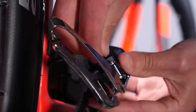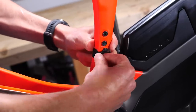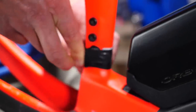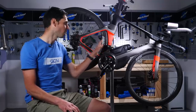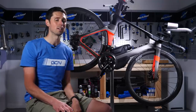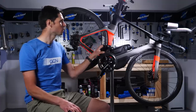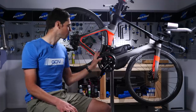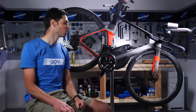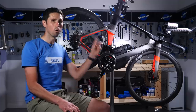Once the derailleur is off, you can decide what to do with the cable. First option: simply tape it out of the way, keep it out of harm's way. If you're going to commit to a 1x setup, you could push that cable to the inside of the frame, but that will be difficult to fish back out should you want to refit the front derailleur — only do that if you're adamant you're going to commit. If you have a mechanical groupset, you'll need to remove the inner cable running through the frame up to the shifter. You can remove all the housing as well for a super clean install, but it's not crucial — just make sure no cables are flapping near your chainring or rear wheel.